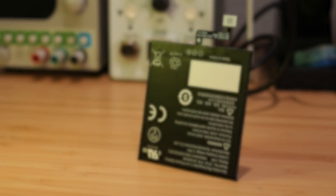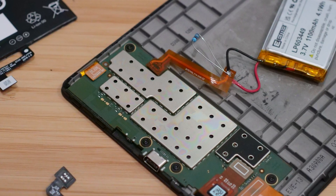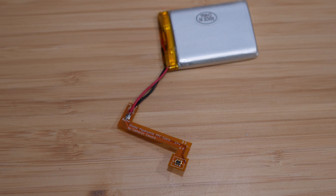That was a problem because I couldn't identify the exact thermistor used in the original battery pack. I could, however, measure its resistance while subjecting it to different temperatures, and I was able to determine that it sat at about 100,000 ohms at room temperature. The new 5,000mAh battery I bought has all the protection it needs built right in, so I concluded that an additional thermistor wasn't actually necessary for safety. The solution was then obvious — I simply connected a regular 100,000 ohm resistor to the RT2 pin. As far as the Kindle is concerned, the battery is always at room temperature, and the battery's built-in safety circuitry should keep it from exploding. For the battery and resistor connections, I designed a simple flexible cable with the files uploaded and linked in the description, which you can have made by a PCB manufacturer.